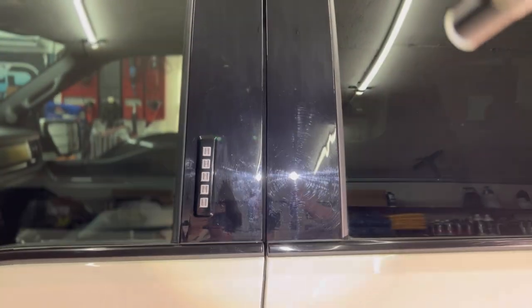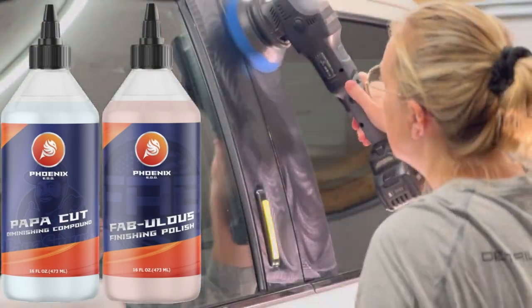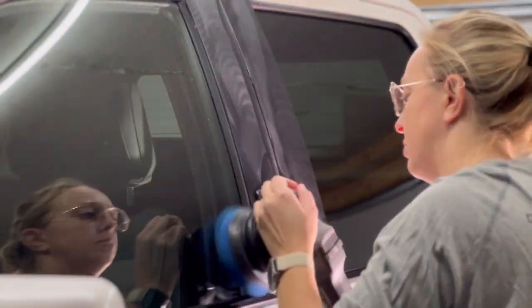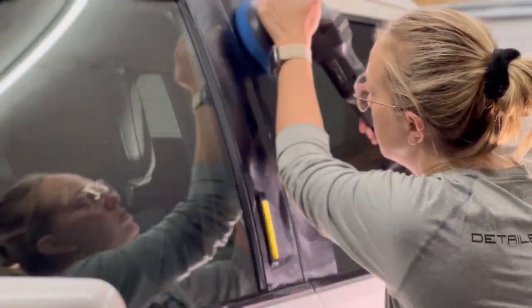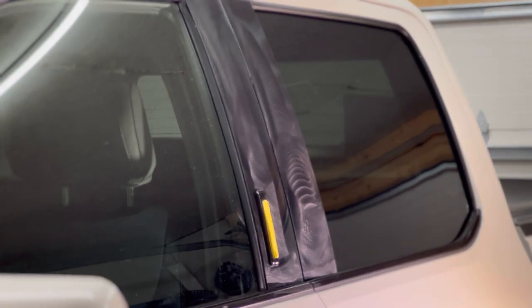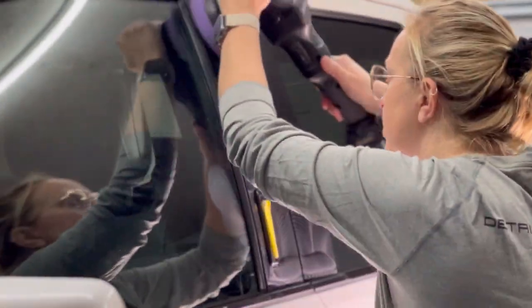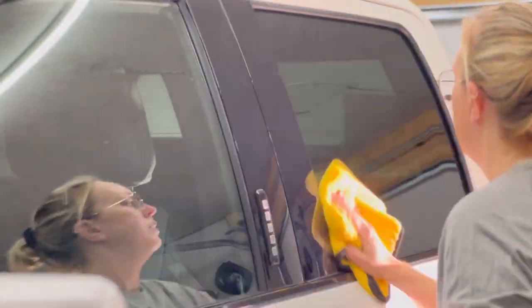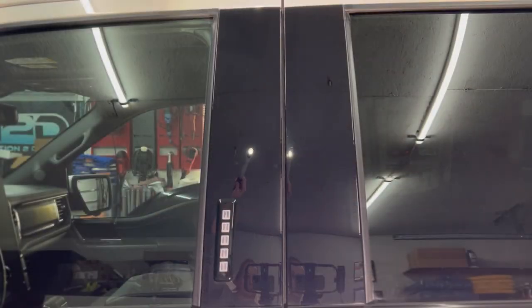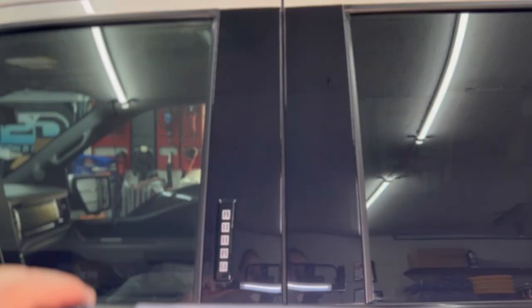Now let's shift gears to our severely swirled piano trim pieces. Piano trim pieces can be difficult to finish down well. We used Pop-A-Cut diminishing compound and Fabulous finishing polish from Phoenix COD. Anytime you have severe swirls like this, you'll need a two-step because any pad or product used for heavy correction is going to create a lot of haze and micro-marring on this type of surface. The two-step with both products worked very well together — if it's not in bad condition you can get by with just the Fabulous finishing polish, but the two-step here did a really great job dialing in these pillars for a flawless finish.